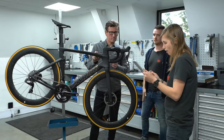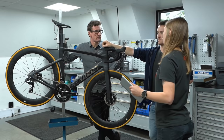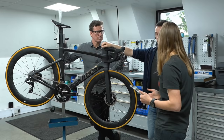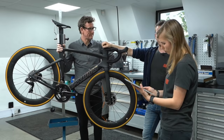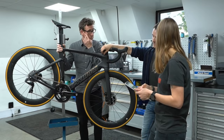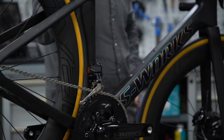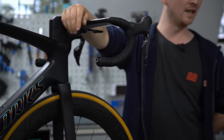Sarah on Instagram asks what maintenance should I be doing to my bike on a weekly basis. I would say cleaning first — on dry sunny days you won't need to degrease as much, but your chain should be reasonably clean all the time. Cleaning, degreasing, and re-lubing. Checking your tyres, because nobody wants to be the person on a club ride who has to stop every couple of miles for punctures — they might have cuts and tears from hitting stones, potholes, or glass.